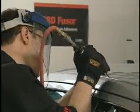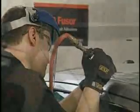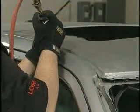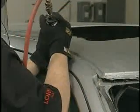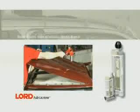Cut out the roof panel at the sides with an air saw, then use an air chisel to separate. Caution must be taken not to damage any structure below the roof skin. The panel will most likely be attached to reinforcing ribs with a foam adhesive. If necessary, use a heat gun to warm the roof panel and remove it from the foam adhesive. If foam is present, be sure to leave it intact for proper installation of the new panel.